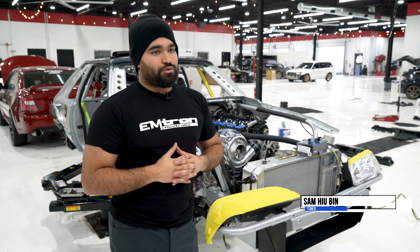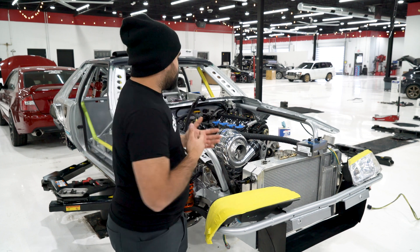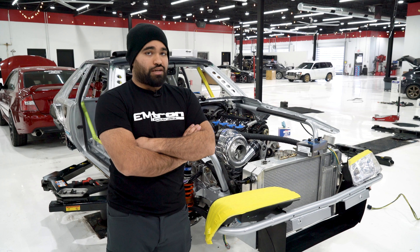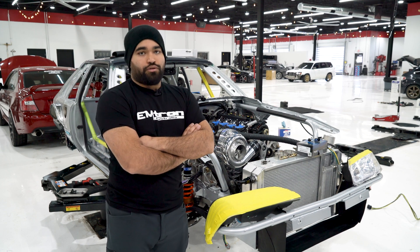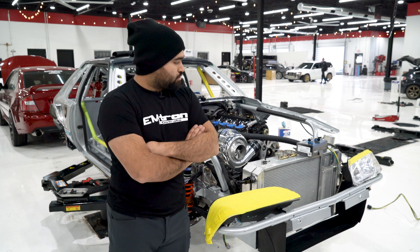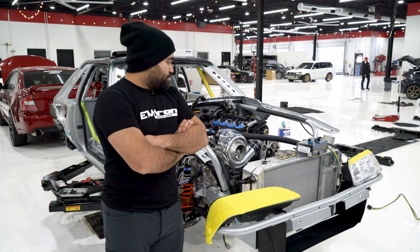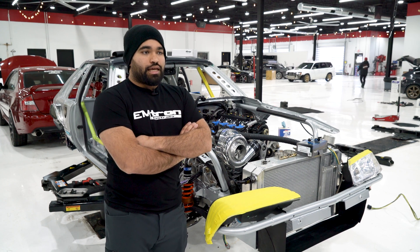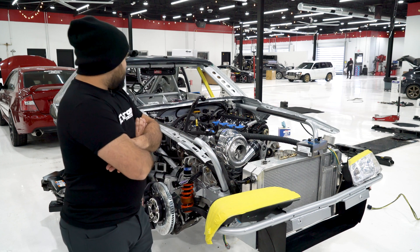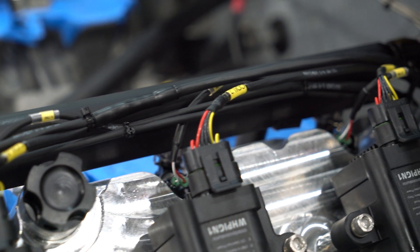There's a lot going on in this car, so we had to rewire everything, which has been a really big undertaking and has taken a lot of time. But because of all that, we want to eliminate as many failure points as possible so we can focus on the unknowns. If we know we can make a wire harness to a spec that we can trust will ideally never fail, then we can focus on the engine, the supercharger, and the driving — which is the main purpose of this competition car. Because of that, we have everything sheathed in Raychem DR-25 using epoxy sealing compound, and everything is service-looped.